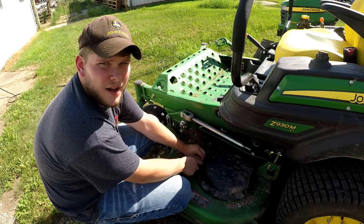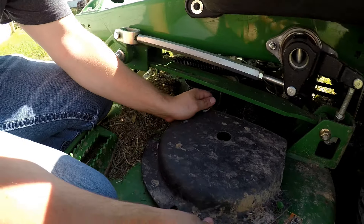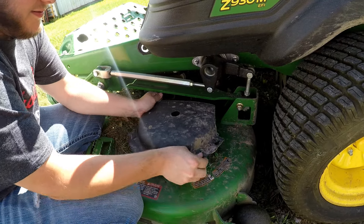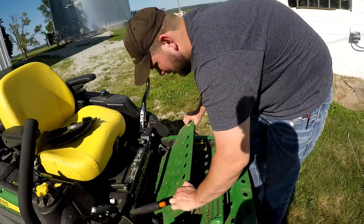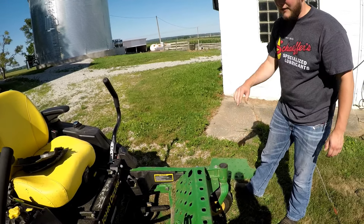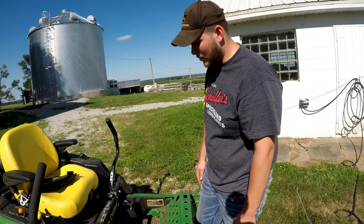There are these little pins — you just take those off and it usually slides like this. Then blow out rocks and stuff that get stuck in there. A lot of people didn't know this part lifts up here so you can get in there as well. I've actually done a lot of service on people's lawn mowers and they didn't even know about that — I've replaced springs and they're like 'wow, I didn't even know that comes up.'